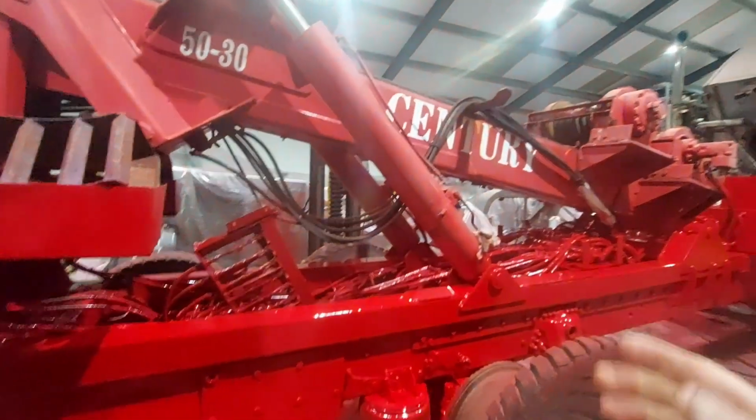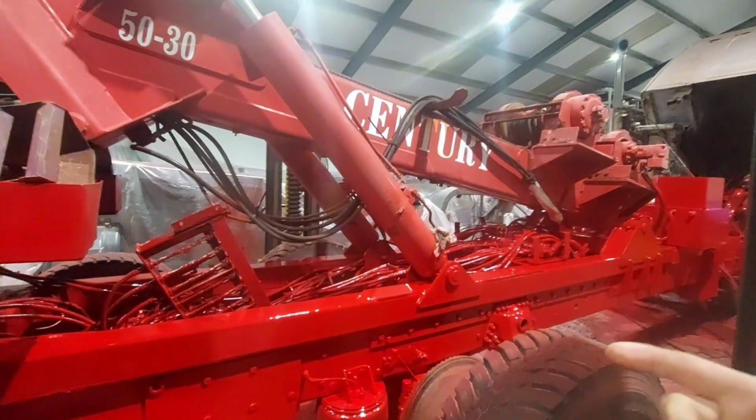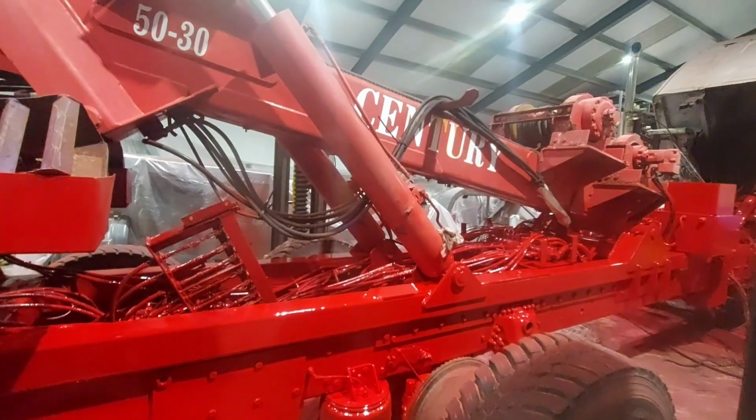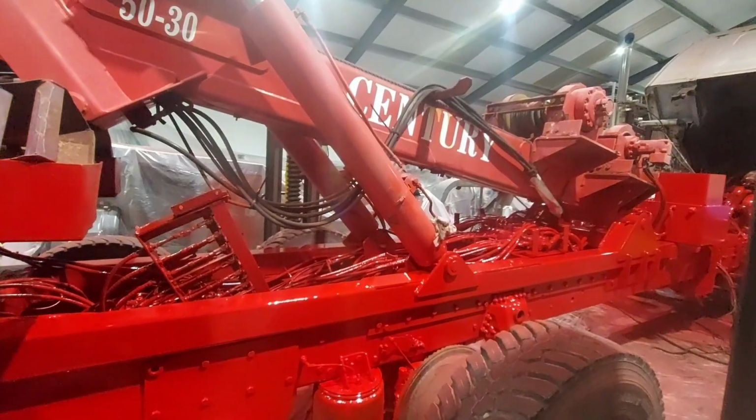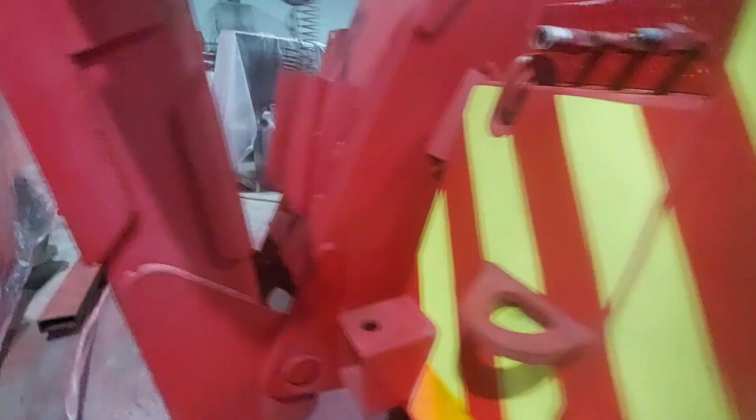Obviously with the shot blasting being pulled forward, we were under the hammer a little bit because we had to get the shot blasting done, and you can't leave bare steel around for a long time, especially this time of year, because it was just rusting in a matter of days. So the chassis has been done for that reason.